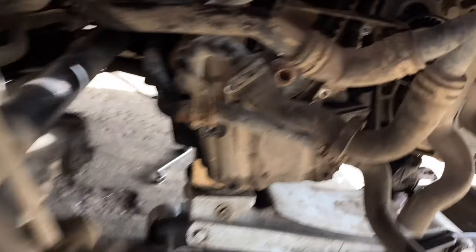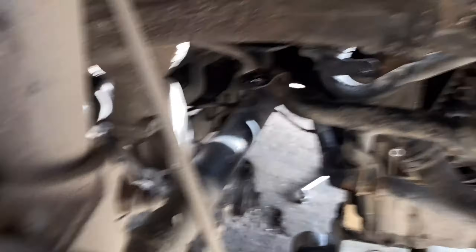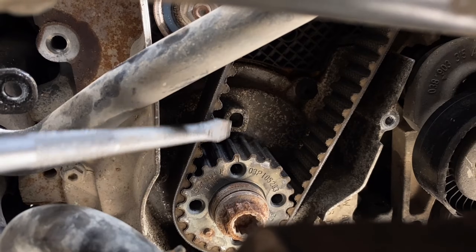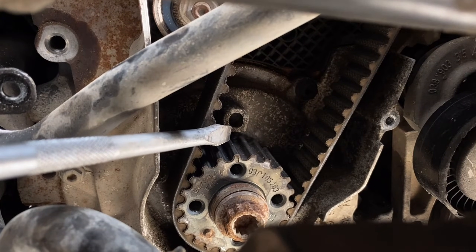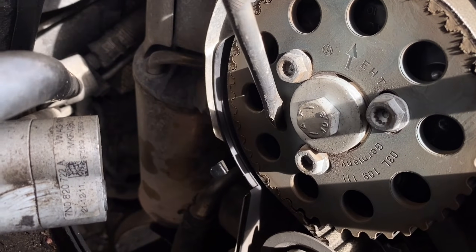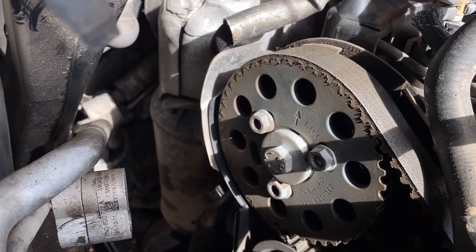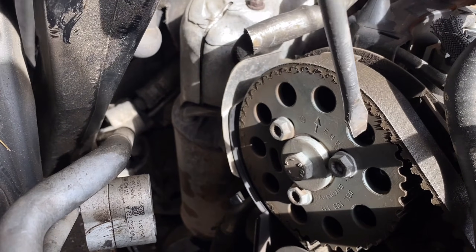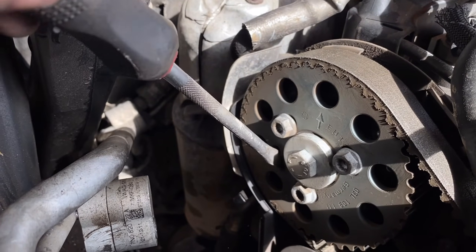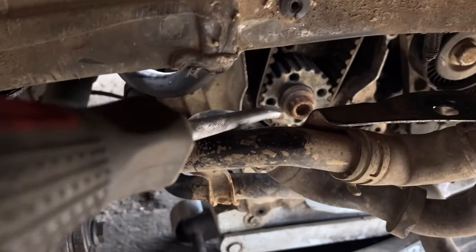Before you even take the belt off, we need to time it up. Just above this bolt we've got a little groove that I need to line up — just to the left of center, you can see that little groove. Now at the top, you can see a cutout — that is where the cam locator goes. If you've rotated your engine so the bottom is facing up like in the video but your hole is up at the top, rotate the engine all the way around again until your locator hole is more towards the bottom left-hand side.